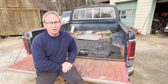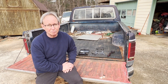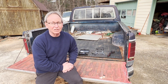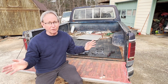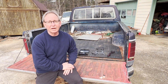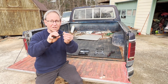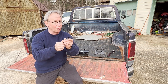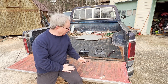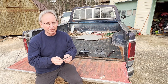The message I want to put out there is: if you have an aluminum block engine — it doesn't matter who makes it, what make, model, or size — the manufacturers do not put inserts into the aluminum when they thread the steel bolt in. It's pretty much only meant for one time, and you're going to find this out probably on your last head bolt. They all use torque-to-yield bolts.